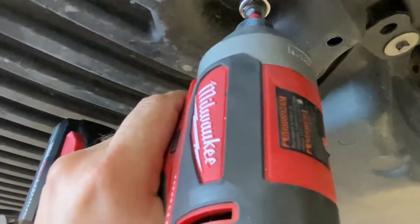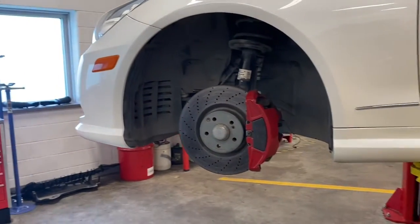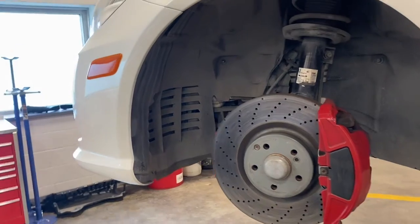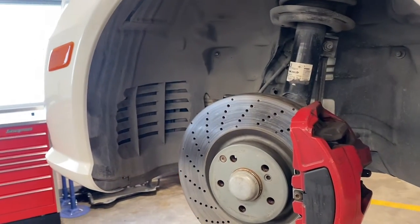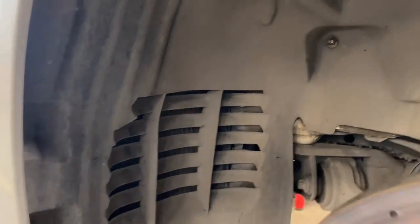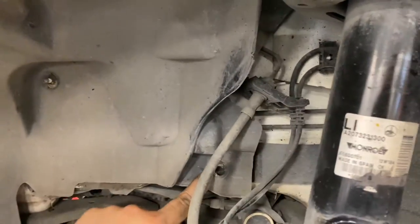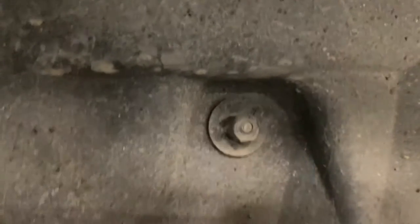To remove the lower shroud, I'm going to be using this impact with an 8mm socket — that's probably the easiest way to get everything out. Next, you're going to remove your actual wheel on the driver's side. I don't know if the W212 has the exchanger on the passenger side, but on this coupe it is on the driver's side and that's how you can see the actual heat exchanger vent. You're going to remove a couple of bolts — one there, one up there, one there behind the brake line — they're going to be 10mm bolts, made of plastic.